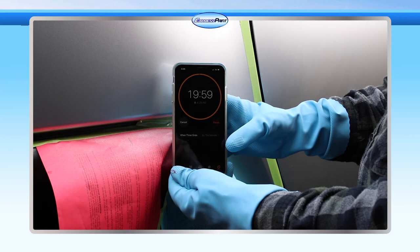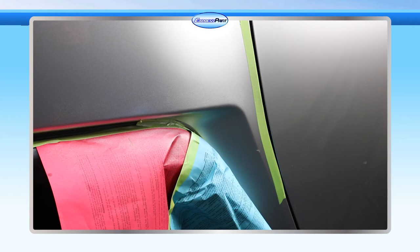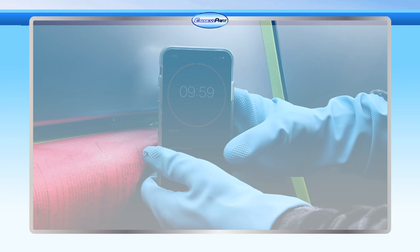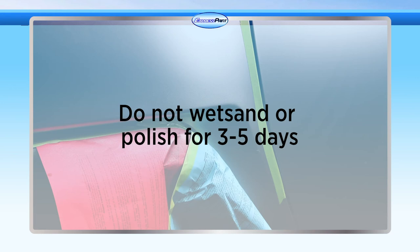Allow the paint to dry for 15 to 45 minutes before moving on. All dry? Good. Now you want to apply two to three medium coats of appropriate clear coat. Let these dry for 10 minutes. Be sure not to do any wet sanding for three to five days after the paint job has been completed. Waxing may be done in two to three weeks.